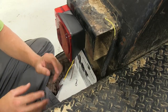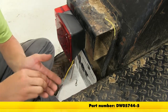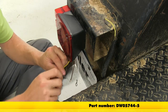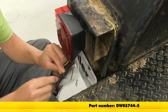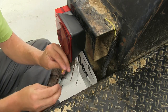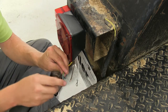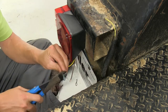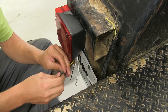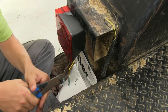Now we can start connecting our wires. Since we're working on the outside of the trailer, we're going to be using some heat shrink butt connectors, available on our website at eTrailer.com. I'm going to start with my yellow wire, clean it up by twisting it just a little bit, then take the heat shrink butt connector and put it in place. Make sure that the wire is not visible and crimp it together. Once it's crimped, make sure it's not going to come back out, then repeat the same process with the brown wire.